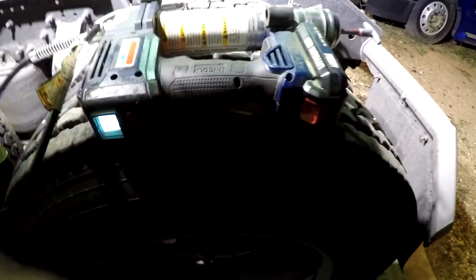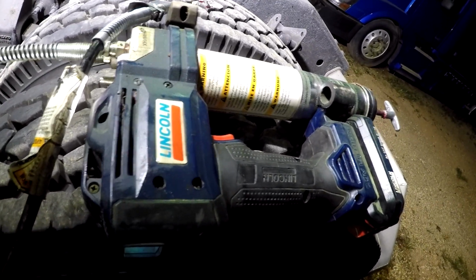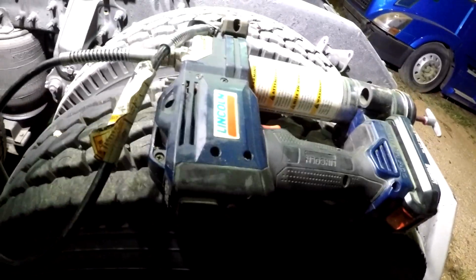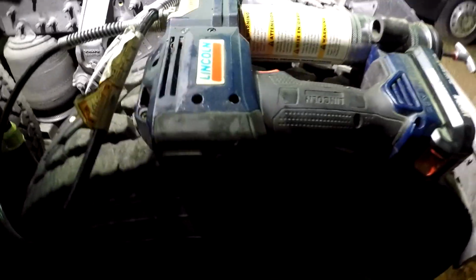If you don't have to grease U-joints. Now, if you got to grease the U-joints, on my other truck, it usually would take about 1 ounce of grease per U-joint. So an additional about another half a tube. So depending on if you got greasable U-joints or if you don't. So anyway, just want to share that with you.